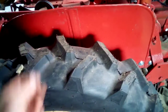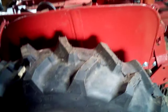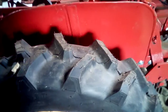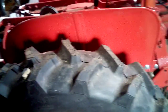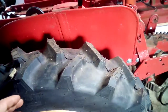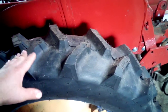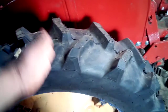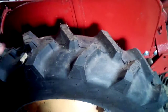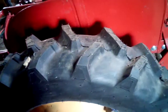So now, since the upper gears are good now, they're probably like 95% versus my 30-some% that I had left. And the back and the lower bull gears, which still had wear, but they're, I don't know, like still 90%, which ain't bad. It's far more quiet going forward. The only time it gets a little noisy is in reverse, but that's because the gears don't quite mesh as nice. I've got the gears basically flipped to where it's running on a side that's hardly used.